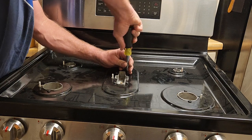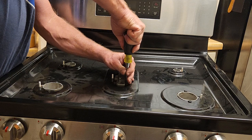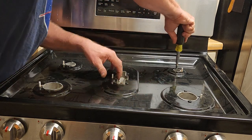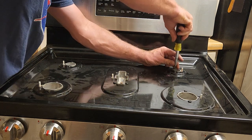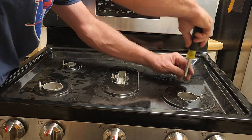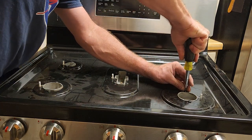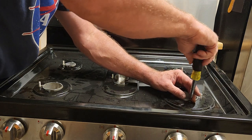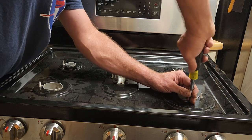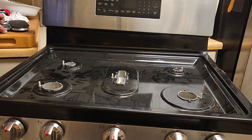Just pull them all. See, I'm doing it with a screwdriver, because if you do it with an impact driver, this is a pewter type metal. It's sintered metal, basically a printed part, and you can easily strip it out with an impact driver. You have to be real gentle. With a screwdriver, I can feel what I'm doing. Okay, that's done. I'll put these back on.